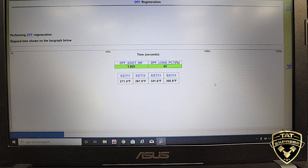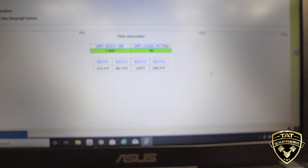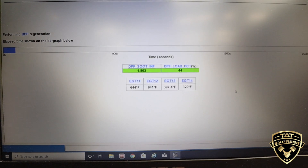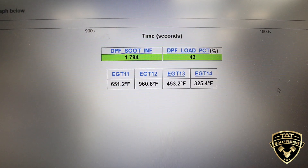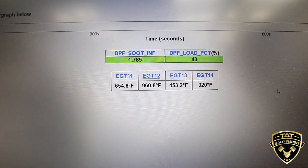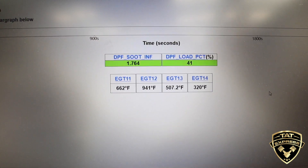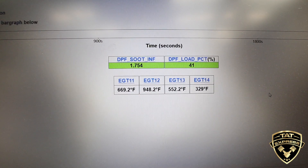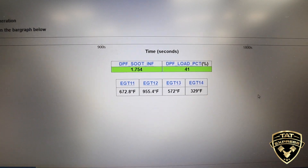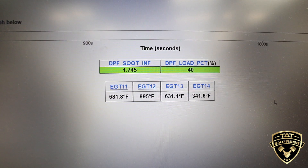Okay, so once the regen starts, you can see the four temperature sensors that I was talking about. As the regen goes, these sensors are actually going to rise in temperature. So here we go. As this regen is in progress, you can see the temperature readings are starting to rise. Now EGT11 is going to be the first sensor, that's why it's going to read a little bit higher first, but EGT12 is going to start catching up to it. What we're trying to do is get it up to over 900 degrees Fahrenheit so that we can get the filter cooked and push out all the loose soot. Once it reaches temperature, the soot that's caught in the filter actually gets loosened up and with the pressure of the engine, it gets pushed out of the end of the filter.